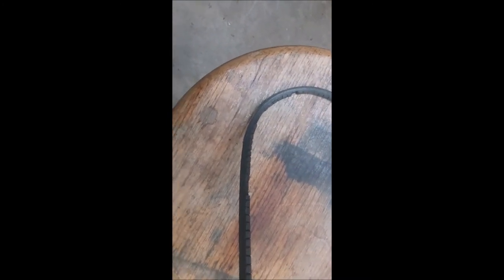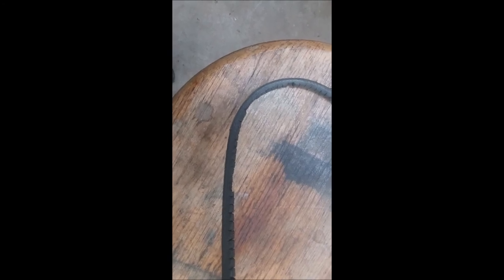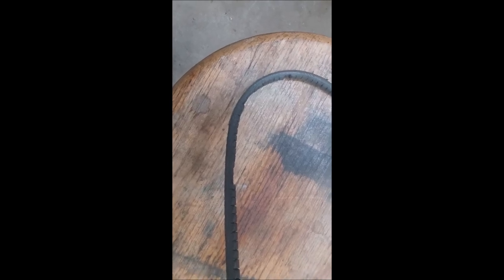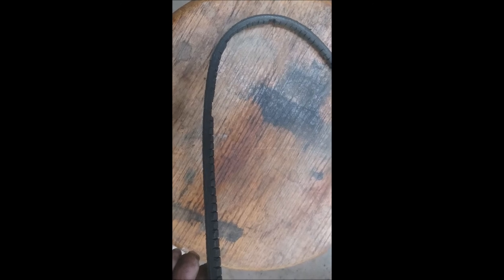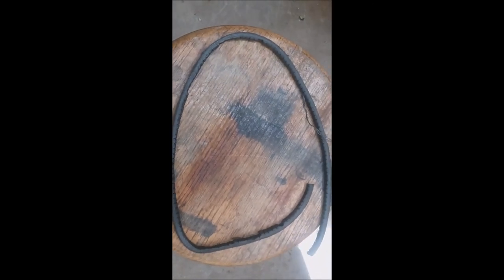This is the belt I took out — you can see it was getting pretty bad. The belt I removed doesn't look like the one I installed: the old one is a cog belt, where the V has slits in it. A cog belt is used so the belt can conform around a smaller pulley without extra stress. Around the alternator's smaller pulley they did use a cog belt, but the replacement belt I installed is not a cog belt.